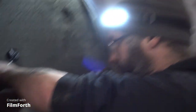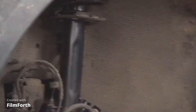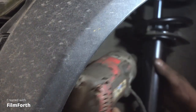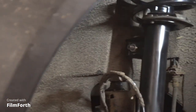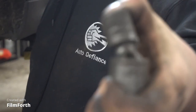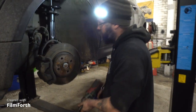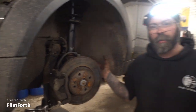Got the anti-roll bar link and we're going to bang it on. Are they 18s or 17s? Might be 17s because they're aftermarket. We'll try it and see if it tightens up. We've swapped onto one of our Snap-on flexible-headed sockets — these are like a ball socket and they're so much better than any of the other universal joints. I give them hell and they're brilliant. Done — one side complete, minus the wheel.